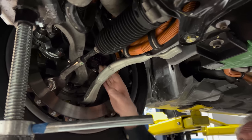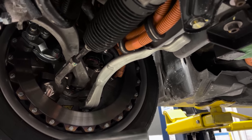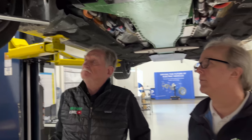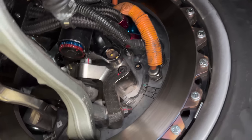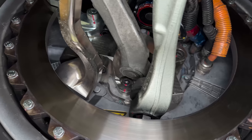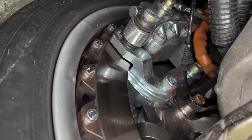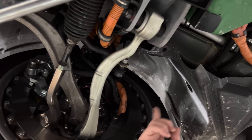The first thing I noticed is something looks different here — this doesn't look like a standard Mercedes part. Tom explains: when they originally installed the wheel motors they had to use adapters, but in the most recent iteration there's a new knuckle design that brings the motor inboard a bit, and a new tie rod end that matches it. The track width is now more in line with the original Mercedes configuration, and it also corrects the scrub radius so you get a good neutral steering feel.